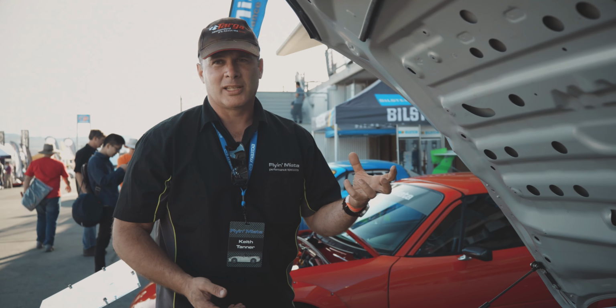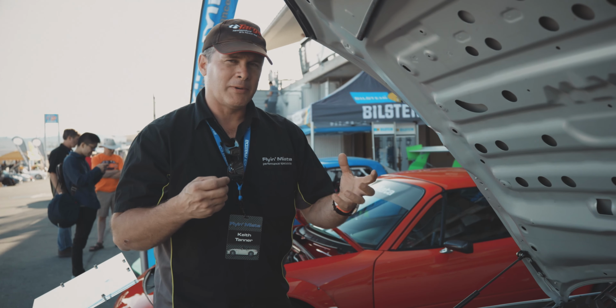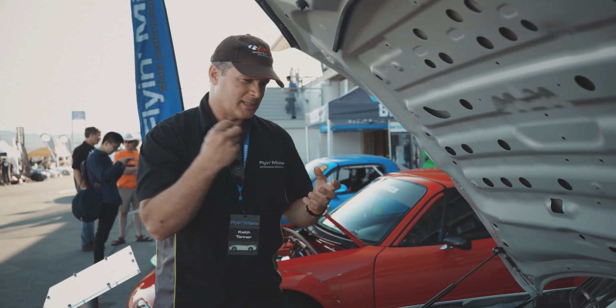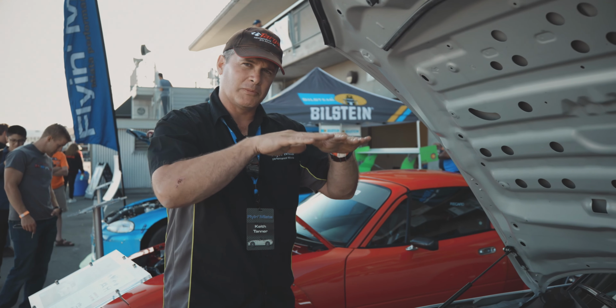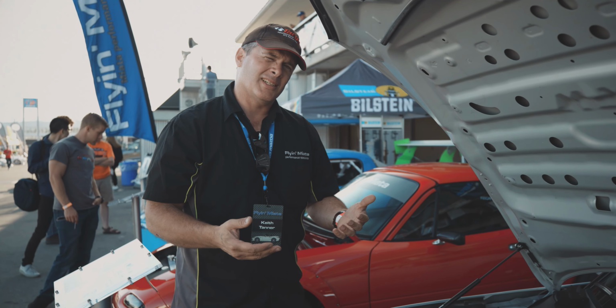The fuel gauge in this thing doesn't work like a normal fuel gauge. It actually works more in dead reckoning, where it receives a little tick from the ECU that says, I just used X cc's of fuel, and the faster those little ticks come, the more fuel it figures it's using, and the faster it brings down the fuel gauge. And of course we had to find that signal in the Mazda system.